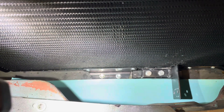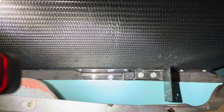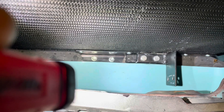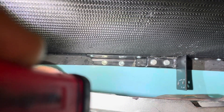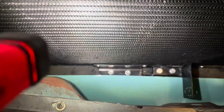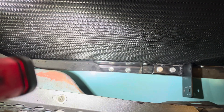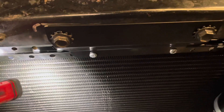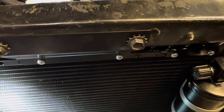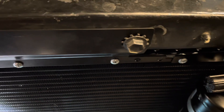So if you remember from a couple clips back where I was talking about the damage to the front end — the OEM mounting point for the hood release latch isn't there any longer. That block on the right side was made by someone else to support the latch assembly. The bracket that came with this kit wasn't going to work because it had to mount around those two bolts over there and go in towards the engine bay. Since that was non-existent, the bracket they gave me was not going to work. I'm still a little skeptical if it even would have worked if that point was there, just because of the height of everything. You can see where it's lining up with the marks that I made for the hood release latch — I painted some witness marks on there so I can put it all right back where it needs to go.